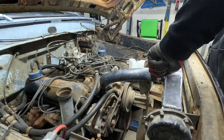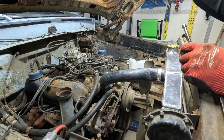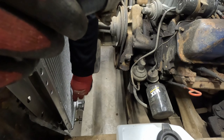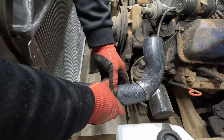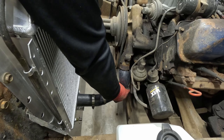Okay, got the new hose on the top. While I was out getting the hoses I also got a new light for the engine bay — much brighter, much better. Now let's do the lower hose. Because this lower coupling on the radiator is damaged, I'm going to put two hose clamps on there and cross my fingers that that's enough. We'll see how that goes.